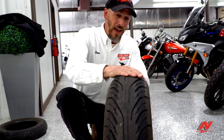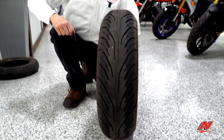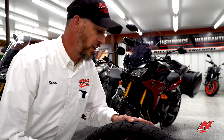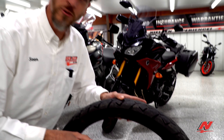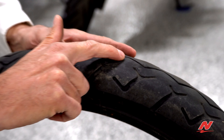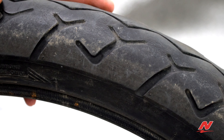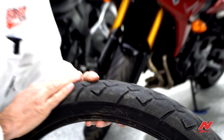This one is pretty flat — it will pretty much stand on its own. Another common issue we can see on older tires is dry rot or cracking. This is a pretty extreme example here, but you can see it's got a lot of cracks within the tread of the tire, also in the tread itself. Some tires you'll also find cracking along the sidewall, which happens a lot from being exposed to weather and sun, which can dry out the tires.